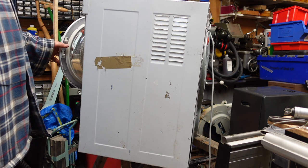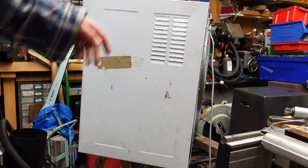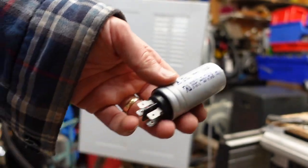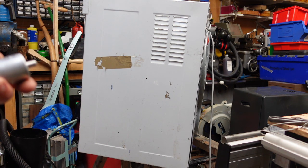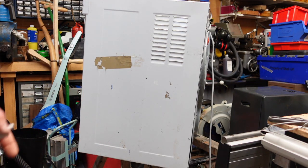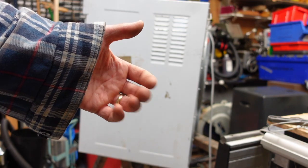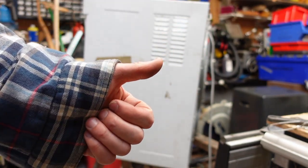So if we open the door — it's hot inside now, because it's obviously working. And when we close it, it works again. So this capacitor here, the old 8 microfarad, is for scrap — it's rubbish. 7 was adequate to get it going, and the 7 must have had enough of a kick to get it going. Save your spare parts if you're ever scrapping something out, because this is the first time I've ever actually repaired one, but having two or three of them in a box meant I had a spare part ready to go when I needed it. So that's a success. I'll put the top back on — it didn't come with screws, so I'll just bung some screws into the back. Job's a good'un. Questions or comments, leave them below. Thanks for watching. Any observations on what I did or anything I did wrong, tell me about it, because it's the only way I'll learn. And subscribe if you haven't already. See you later, thanks for watching.